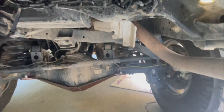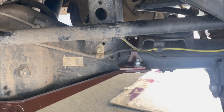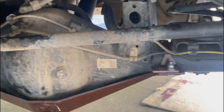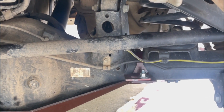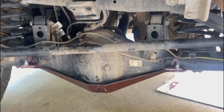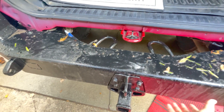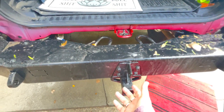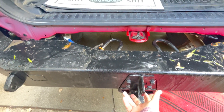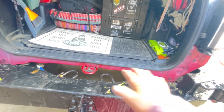The key callout for the lower is these rear brackets. See how this one's long in the back and then the top bracket is shorter in the front? Just make sure when you put them on, you have them in that orientation — otherwise it's never going to fit. Get a buddy to help you lift the bumper in. I hand-tightened these and put everything else in below, because you may need to put those shims in to kind of get it close to equal.